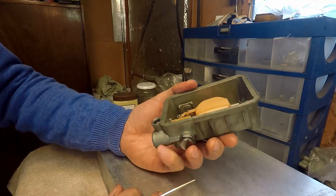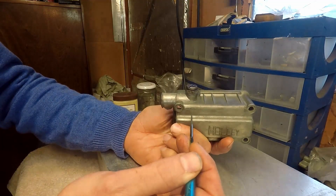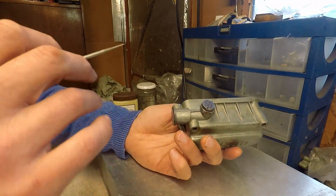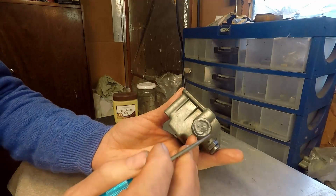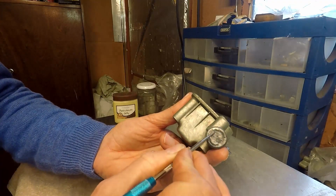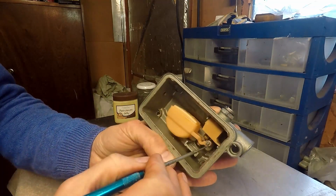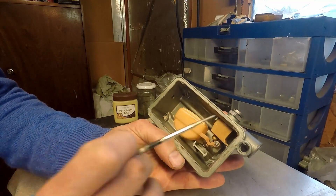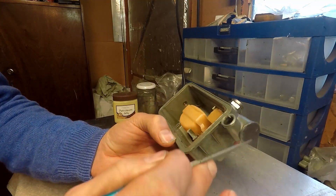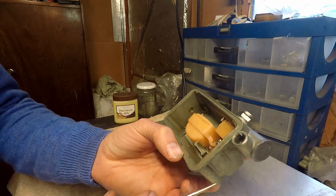I went around the houses a bit, to be honest. At first I thought the fuel bowl itself was broken, but actually it wasn't. Eventually, after a bit of soul searching, I realized that this area here — this seal — had been compromised. What would have happened if I'd put this on a car by just changing the needle and seat assembly is that fuel would have started coming out of here, causing the car to slowly leak fuel, which isn't a great outcome.